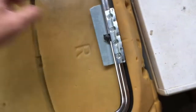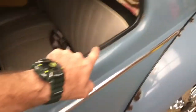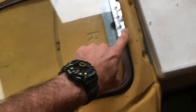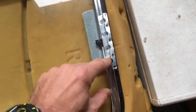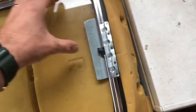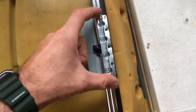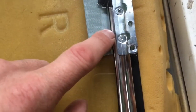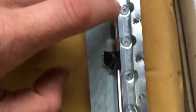But basically it didn't fit very well at all — there's literally about a millimetre gap all the way along the top between the window and the edge. It's too loose on this side and therefore too tight on the other side; it just wasn't sitting central at all, and that's with the hinge all the way as far as it can go. So what I'm going to do is take the hinge off. I've put tape on the window because as soon as you take the hinge off, the aluminium frame just pops open being one piece.